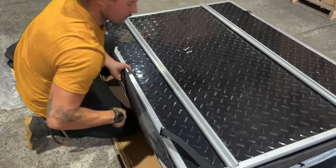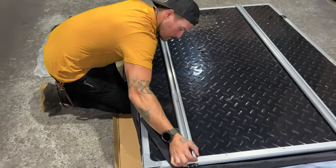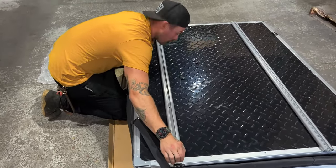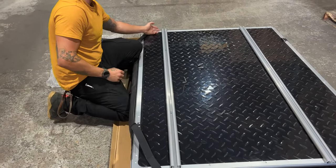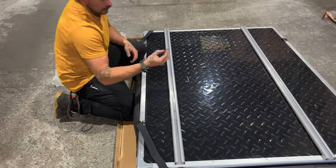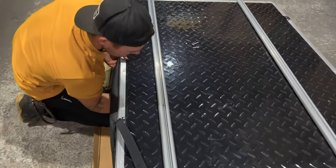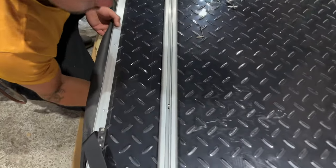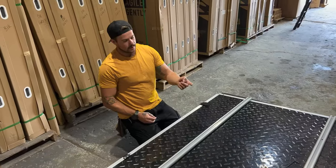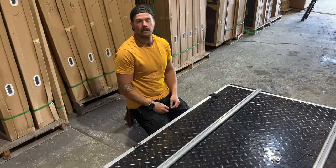We've got that nut just touching the nylock. Then what you're going to do is center that bar just with the tips of your fingers — leave a little tent on that side, a little tent on this side. Then we're going to take the 4mm, go back in there, and actually give these a good tighten. Once you're done on that side, we're going to flip sides and do the same process again to get this side buttoned up.